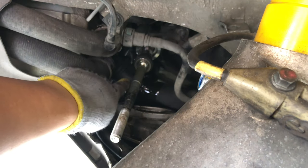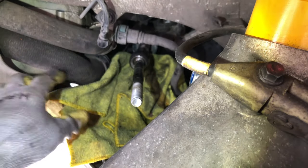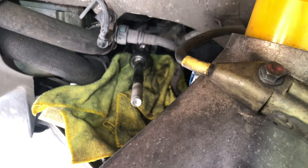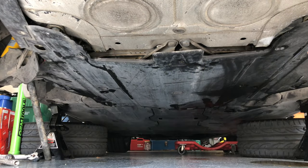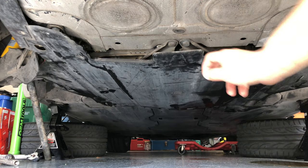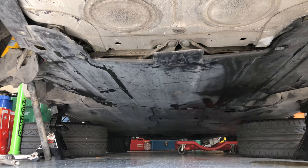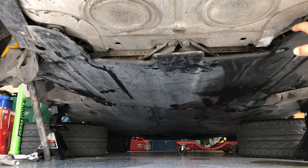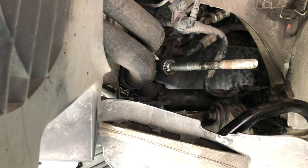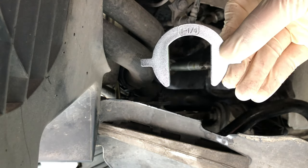You want to wipe the fluid off your coolant lines as soon as possible. I'm going to throw a rag in here to help soak some of it up. Now we're going to go to the front and drop the belly pan. I already went ahead and loosened all of the Torx screws — it's a Torx 25. Now we're going to get our inner tie rod end removal tool. This is the size I'm going with — it's a one and one-quarter inch.